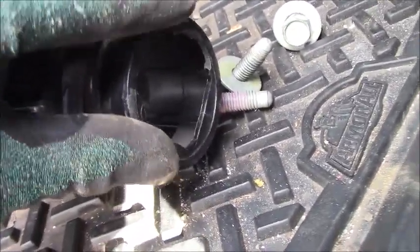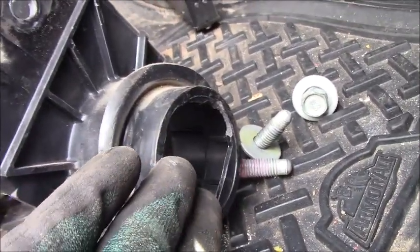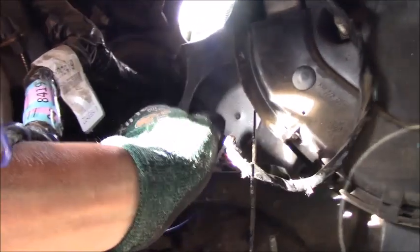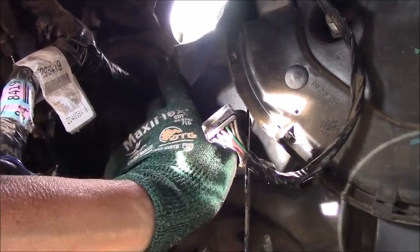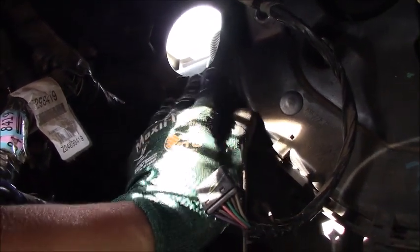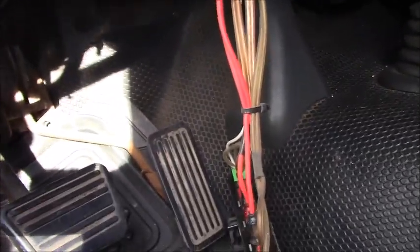The master cylinder mounts from outside under the hood. Once you loosen all the bolts, use your finger to crack it in from outside and it will pop out through the hole in the firewall — the same hole we talked about earlier where I already moved the seal out of the way. Track the seal out to the side to stay away from the assembly, and with one hand pulling the assembly down, it comes out.